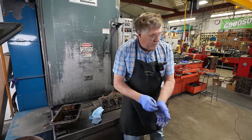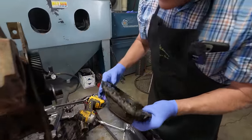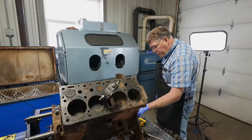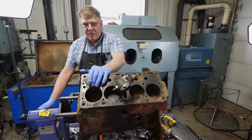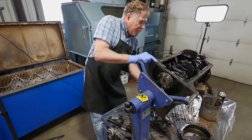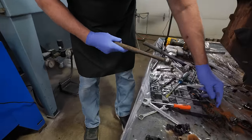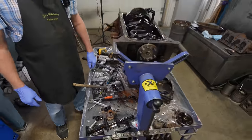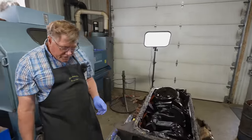I think I'll start over with some clean gloves again. We'll pull the timing cover off. And yes indeed, somebody has been in here before because there is silicone all over the place here. I'm almost wondering if maybe somebody just did a re-ring on it at some point, because it does appear to be standard bore size yet. For whatever reason they've had the oil pan off. And look at just all the dried-up rust falling out of the block here — I don't know why this had no coolant of any kind in it. I hope we don't find a major issue with it. I haven't seen anything yet.